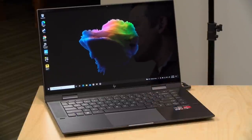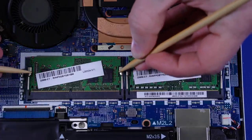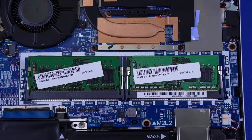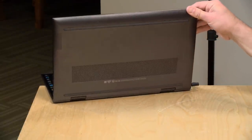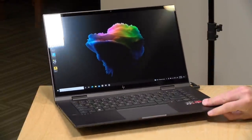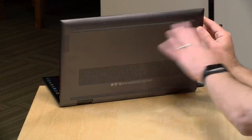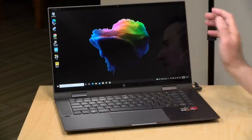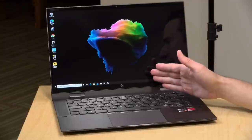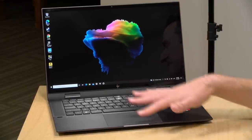It's pretty upgradable. Our demo unit came with 16 gigabytes of RAM, but you can upgrade it — there are two RAM sockets on board. HP doesn't recommend doing this yourself, but if you're savvy enough, you can easily upgrade the RAM. I believe this machine will go up to at least 32 gigabytes, and it supports DDR4-3200 memory. To get inside, you do have to remove some rubber feet on the bottom, so be careful to get those back on. It has 512 gigabytes of storage on an NVMe, which is also upgradable. The Wi-Fi card, which also handles Bluetooth, is made by Intel and can be upgraded as well — good upgradability overall, not something we typically see in more premium laptops.